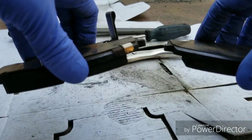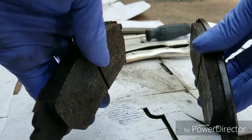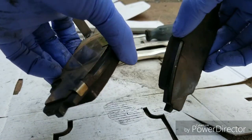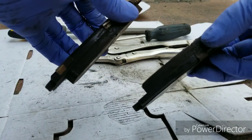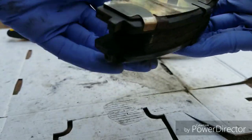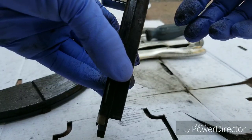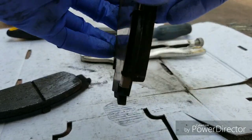What I mean by that specifically is how to balance the wear between the inboard and the outboard pad. In order for this to be effective and as simple as possible, you do need the pads to be symmetrical. The S2000 AP2, and I also believe the AP1, will have pads that are similar from the inboard to the outboard. What you want to do is actually be able to move the pad that normally sits on the inboard side, right next to the piston, to the outboard side.